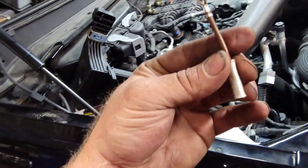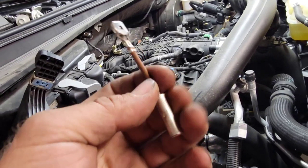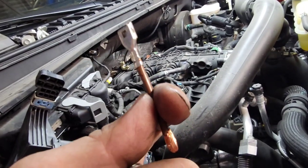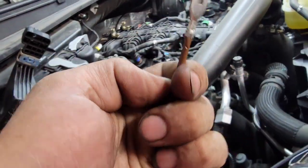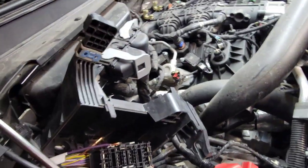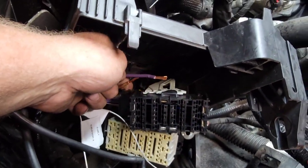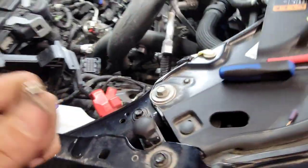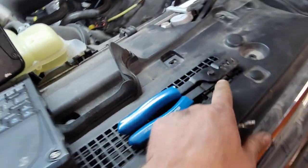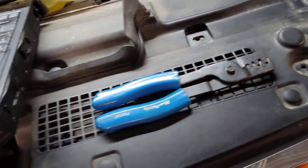What they want you to do is get these big butt connectors — they've got teeth inside there that grab the wire. They want you to fold the end of the brown wire over — the one that goes to the factory harness. You're taking the purple and the brown, the rest of the brown that you cut, and putting them together in the butt connector, crimping them down with the heavier duty style crimpers — like battery terminal crimpers — and then heat shrinking them together.